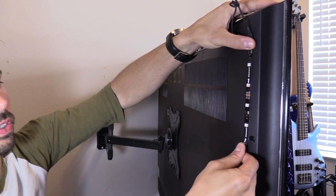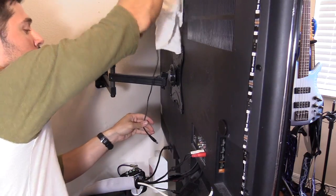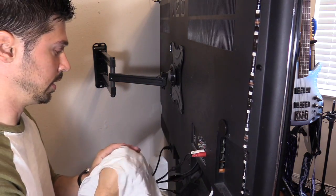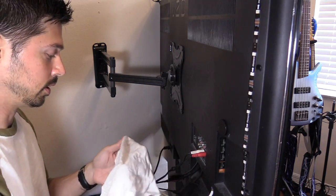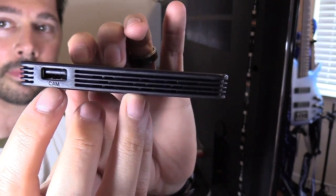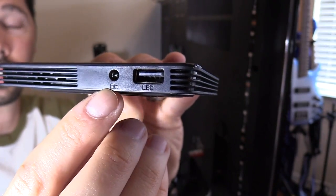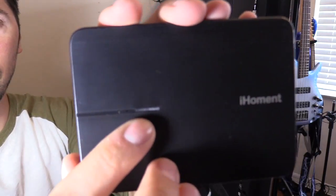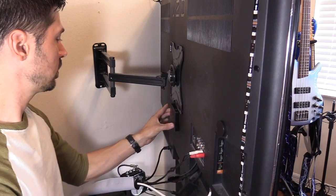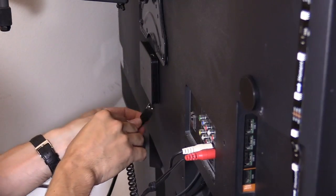So we can still take off the back cover later on. Let's find out how long this cable is for the camera — it's long enough, I could probably put it on the bottom, so I'm going to go ahead and do that. This is a 46 inch TV, if you're wondering. Let's clean the surface right here. It's labeled camera, so you can't really mess that up. On this side right here, you plug into the LED strip, and this is your power. This is the LED light letting you know it's powered on. I'm going to mount it right here, and we're going to take the LED strip cable and plug it in — it plugs in the bottom right here.